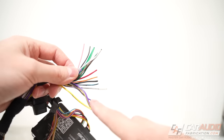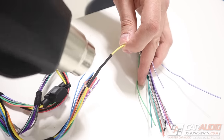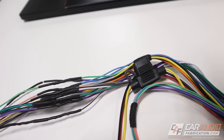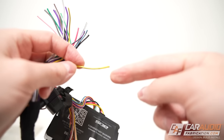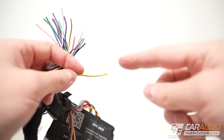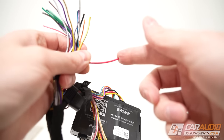With an aftermarket radio integration device, connecting the wires from the radio's harness to the integration harness is pretty easy — for the most part you're connecting the same color to the same color. Always verify by reading the manual for your integration device and radio. First off, we have yellow — this is the 12-volt positive constant lead, meaning you'll always have 12 volts on this wire even when the radio is off.